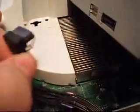Now, there are two cables into the back of your disc drive: the SATA cable and the power cable. You're just going to grab by the white part — not the cords — that way you don't rip the cords out of the back. And this one here is normally hard to get off, so you just want to pop it out like that. Lift out the drive — and ta-da. Basically what you're going to do when you're putting in the other drive is just sit it back in and plug those up, then repeat the process of putting it back together. And that's about it. Alright dude.